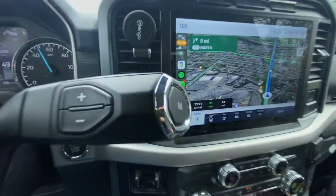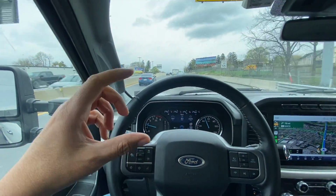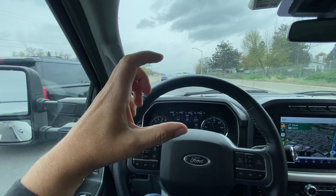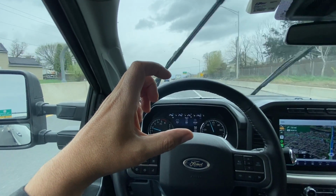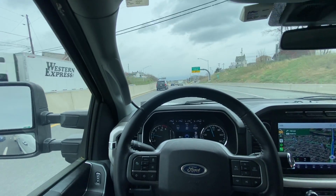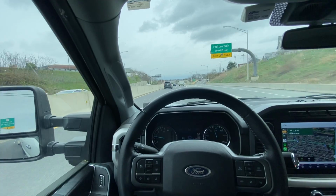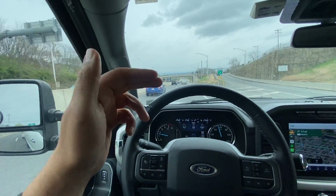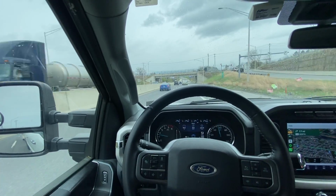And so you're constantly having to work these buttons, the plus and minus buttons, to lock out the upper gears of the transmission and take it from a 10-speed to a 9-speed to even an 8-speed, and in some cases all the way down to a 7-speed. 7th gear being your direct drive, your 1-to-1, and 8th, 9th, and 10th being your 3 overdrives.